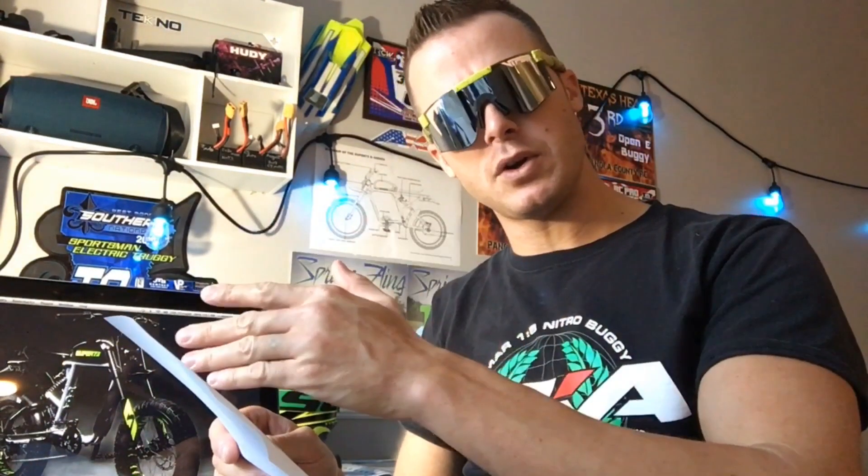Don't drink and ride this thing either, unless you're on a closed course off-road. Check the condition of your tires to make sure your tread is in good condition. Maintain proper tire pressure between 27 and 30 PSI.